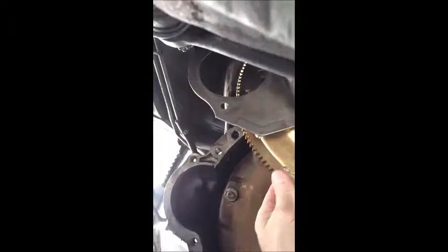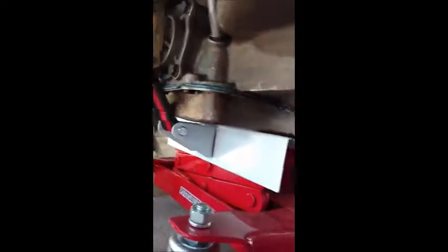So what I've done is I've gotten the Mustang up a lot higher so I can get underneath it, which is smarter than it was when I tried to do it previously. We've got the transmission dropped. I had to pick up a transmission jack — using just a bottle jack wasn't going to work. So I've got it dropped down, and the key is I have to get these lined up. Now I've got good spin on the torque converter, so I'm sure that's where it needs to be.